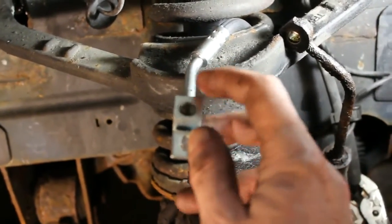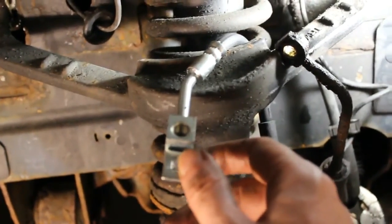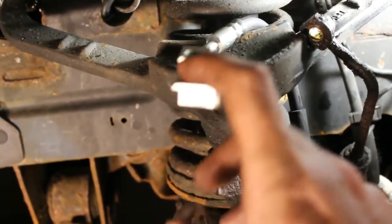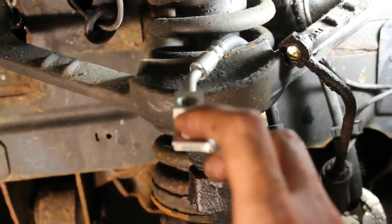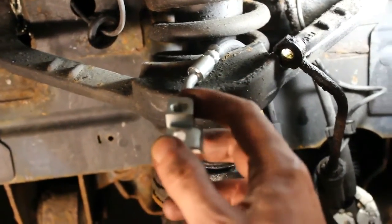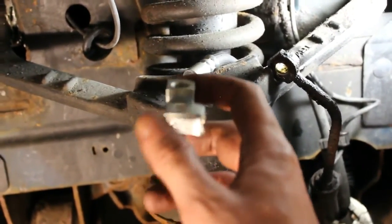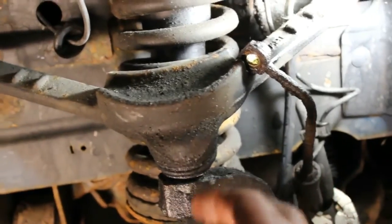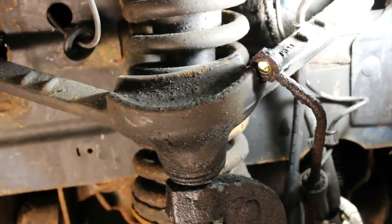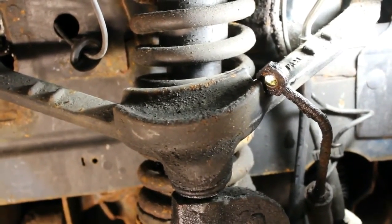So it takes a few minutes, so you're going to lose a little bit of fluid, but I have a drop pan below, and you know, the quicker you do it the better. And then we're going to loosen the bleeder and just do a gravity bleed while maintaining the level in the master cylinder. I did not have to do a complete bleeding of all the brakes because I did crimp this line. You don't want to let all the fluid run out of the cylinder. If you do that, you for certain have to go through each wheel and bleed each one of them.